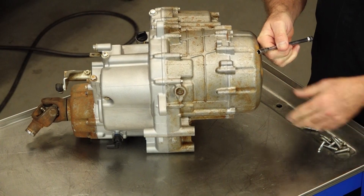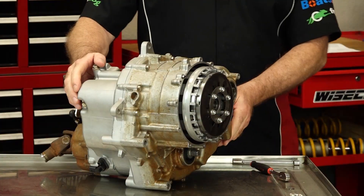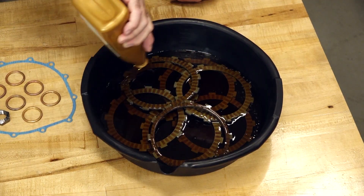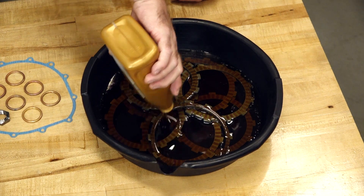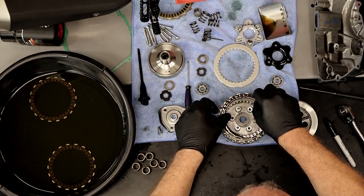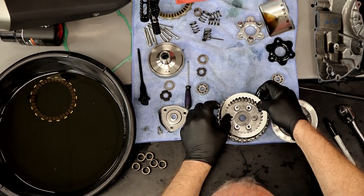Now, on the other side, when you have a wet clutch, you're going to have the clutch housed inside the crankcase. We have a lot of videos where we've rebuilt the wet clutches on a motorcycle or ATV, and the first step is always to soak the clutch plates in oil before you install them so they will be sufficiently saturated. All of that oil helps since you've got lots of friction inside that clutch system, and that oil keeps them cool. Their design also keeps them small and light, and that means less weight for your motor has to push, giving you a little bit better power-to-weight ratio.